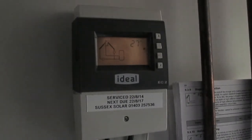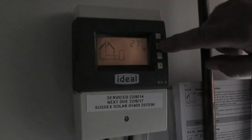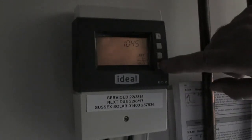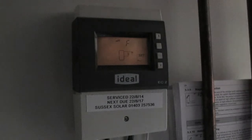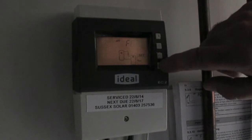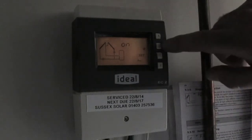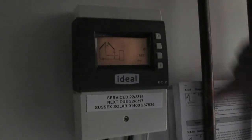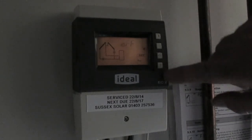When you come back from holiday, to set it back to normal mode, press the set button for 2 seconds, press the down arrow until you get the F, press the set button, press the down arrow until you get 10, press the set button once, then press and hold the set button for 1 second. When it's flashing, press the down arrow — now it's off.